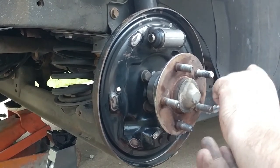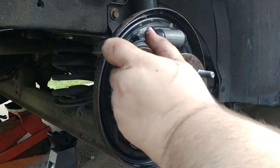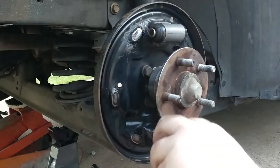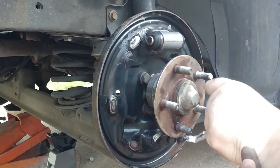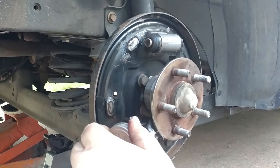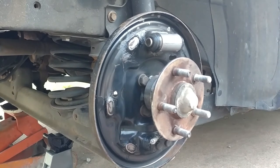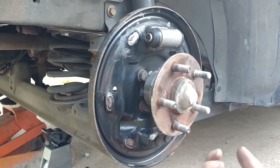This stuff's good for bulb grease too, and it's just some smart stuff to have around. It's good for electrical connections. It's good stuff to have in your toolbox for whatever. Here it's only used for protection on these things. And trust me when I say, working with him, this man uses this stuff on almost everything. It actually works good, and that's why I started using it. I just put a thin layer on it. When you go to put brakes together, we're going to use it on your brake joints, on all the joints in the brakes.